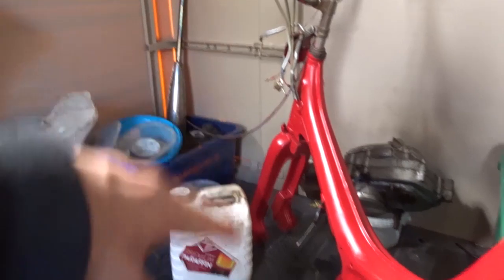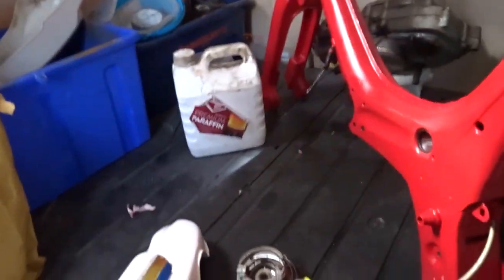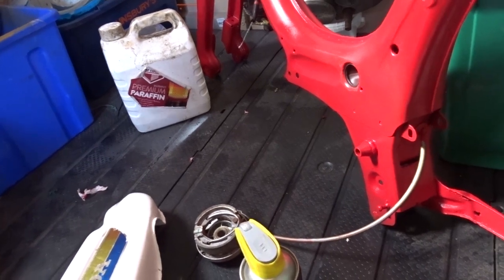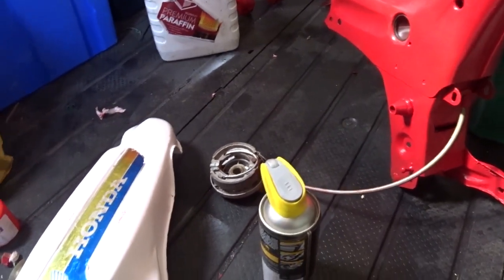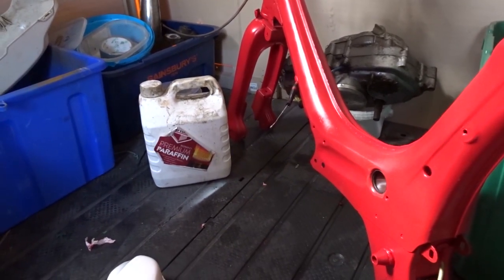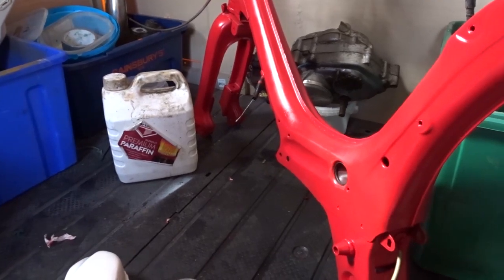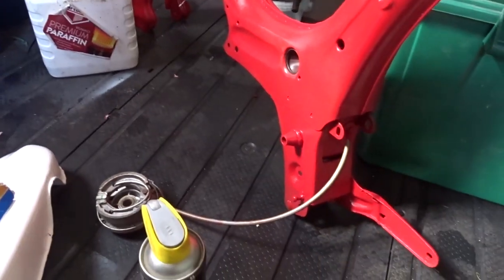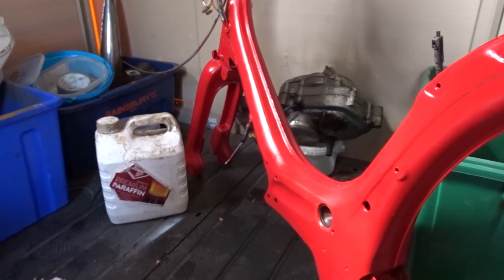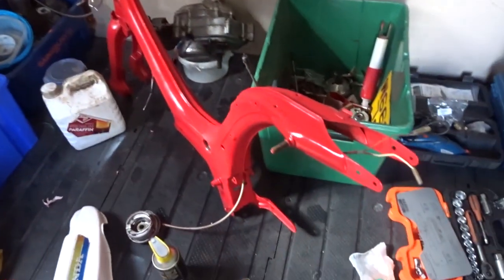I've lubed the cables as well, so now they actually move. So I'll have working brakes. I really didn't think that they would move ever again, but Mr. GT85 and leaving it to soak for an hour brought them back to life. Yeah. Oh, it's gonna be a shame when, or if I can get this all running. I'm definitely going to cycle around on it though. I won't have an exhaust for a while, but I could probably cycle around on it for a bit.